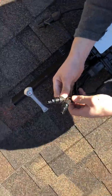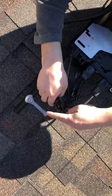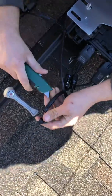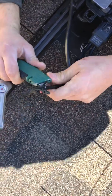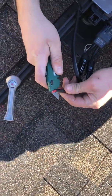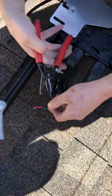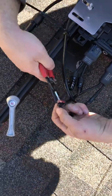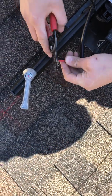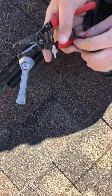Here I'm going to use what we've already started with, and I'm just going to cut away the MC4 heads that were put on this 12 gauge wire. Use a knife to cut away the electrical tape. And similar to how we started before, I'm going to expose just a little bit more of the wire — peel the jacket away, use the wire strippers, and cut the jacket. Cut it down just a little bit more, then strip using the 12 setting — about that much.